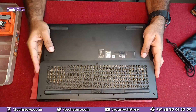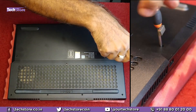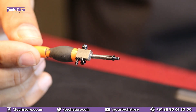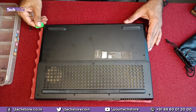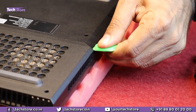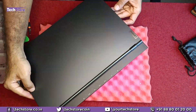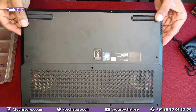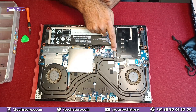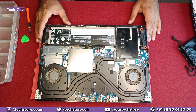First thing first, we'll flip the laptop and you will see all the screws that have to be removed one by one. Take a star screwdriver and start removing the screws. The four corner screws are smaller in length, so keep them aside. Now take a triangular pry tool and start prying from any of the edges, then pry along both sides, and the lid will come off very comfortably. These are the internals of the Lenovo Legion 5 — you can see the battery, the M.2 SSD bay, secondary M.2 SSD slot, hard drive bay, dual fans, RAM area, and heat sink. Literally everything is very much configurable.